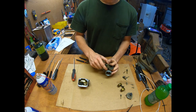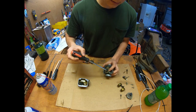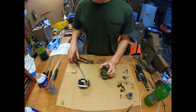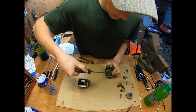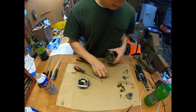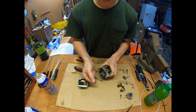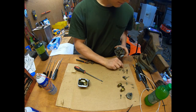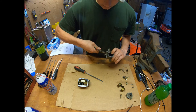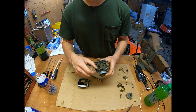I'll take out this little baffle here. It looks like it contains the needle seat, and the seat on this may be replaceable. Looking at the drawing — yeah, looks like it comes out. Some of these come out, some don't. There's a seat retainer right there that looks like a little shifting fork, and then the seat should come out if you want. Yep, seat's out.